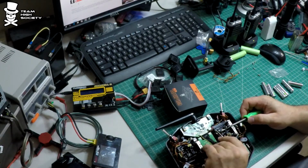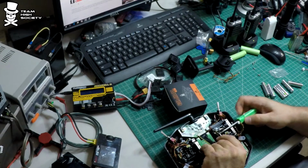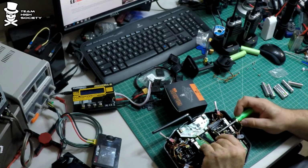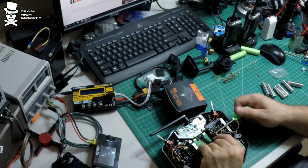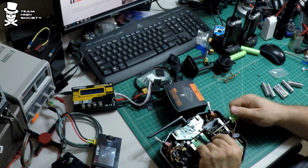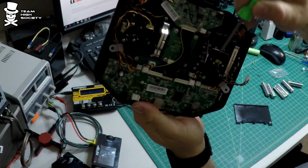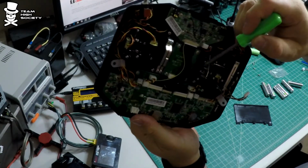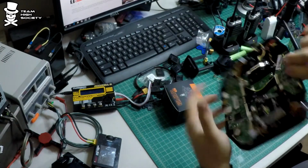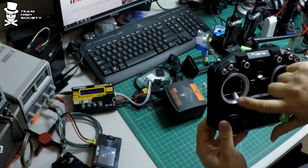You lift this lever up and thread this through this little metal piece. And basically what that does, it just holds spring tension on this thing so that it's out of the way. Try to show that. So that's the screw we just installed, and it rests right there, and it holds the tension on this little spring here. So now it's notchy, but it doesn't return to center.